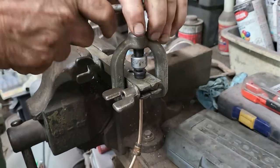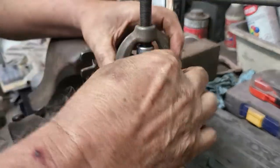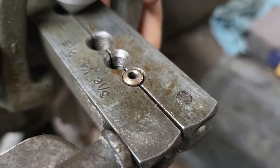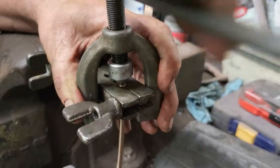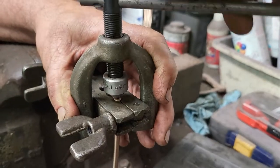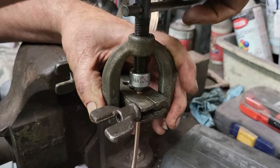It doesn't have to be completely super tight that Hercules has to loosen it — you just want it snug, like you see here in the photo. Once it stops, back it off and you are left with a mushroom. The 45-degree angle on this tool — and you can get these in different degrees, by the way — will go down into the brake line and mushroom everything so it will seal off good.